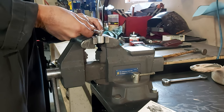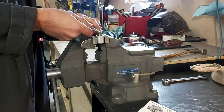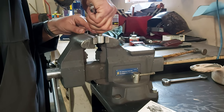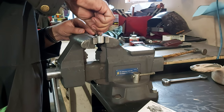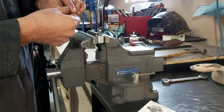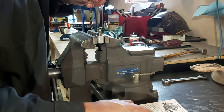This came out of a GM LS power steering pump. We want to reduce the pressure from 1,300 to 1,350 down to a thousand PSI so we can use it with our Mustang rack and pinion steering — they take less pressure to operate, about a thousand PSI. So there was a spring in here, so you've got to be super careful — it'll probably jump out.